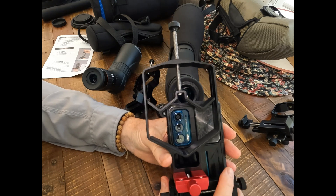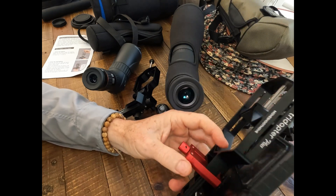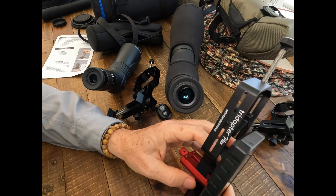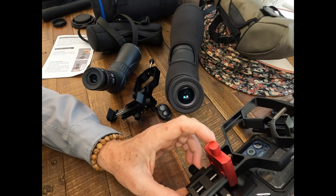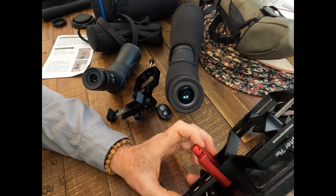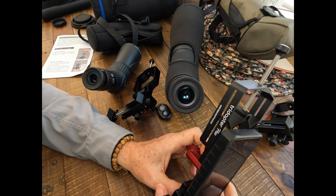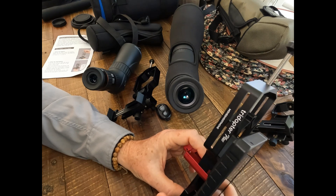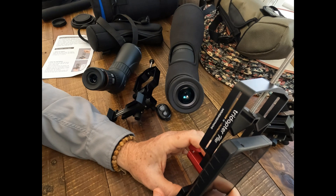Going over the basic design and function: it fits really firmly on the phone, is very lightweight, made of CNC aluminum, and very easy to attach. It's self-centering and adjusting, and then you have your three adjustments. When you do digiscoping with a cheap adapter that only has two adjustments — especially just up/down and left/right — it's really the depth adjustment that's the hard one to get right, to get the perfect fit of your phone lens to the optic lens.